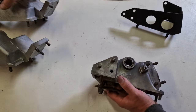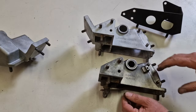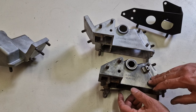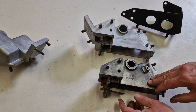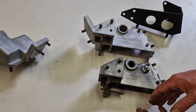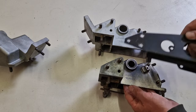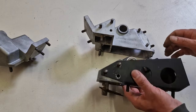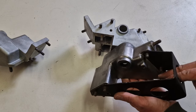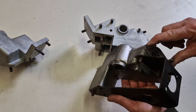This looks very much the same as this. So they took this off, and the reason was they now installed the brake master cylinder, or the servo. They had a servo, not the bellows anymore, mounted to the bulkhead underneath, behind the pedals on the outside in the engine bay. So they had only this mounted here. Then here was mounted the master cylinder, which was a tandem and not the two, one over the other. Here was again the clutch.